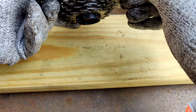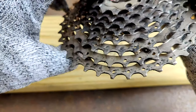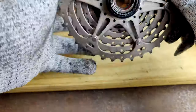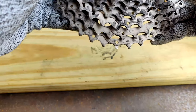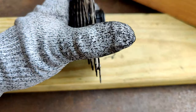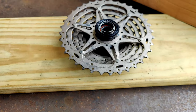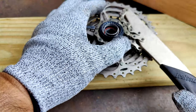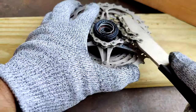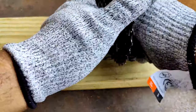I'm going to get this shell off first. I'm doing this again because the hub shell is aluminum by default — DT Swiss does offer the steel version for around $50 to $55, which should prevent the cog from digging into the shell. That's going to be important since I'll be using only two chain rings on the next setup.